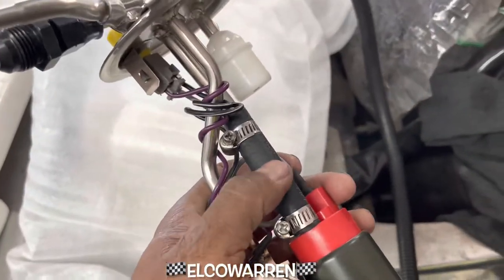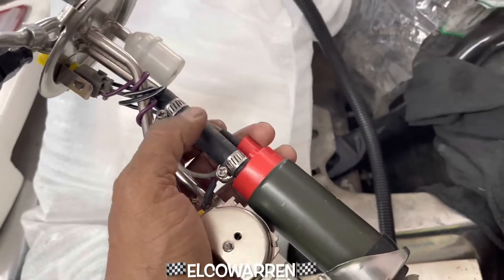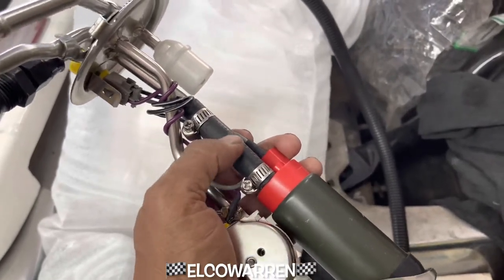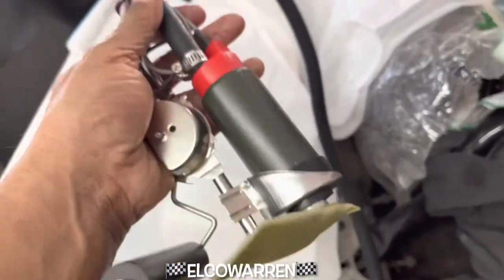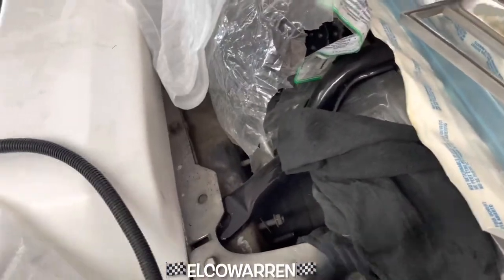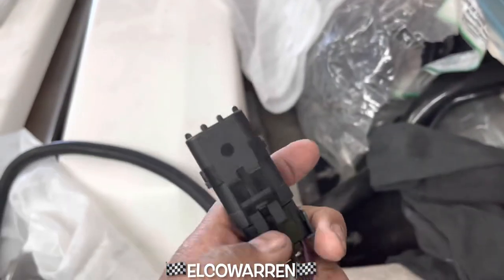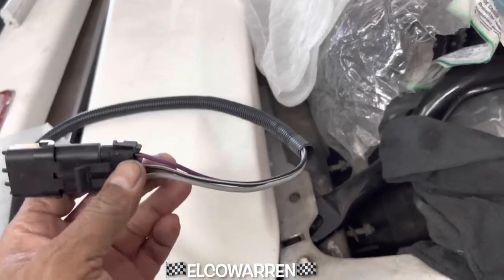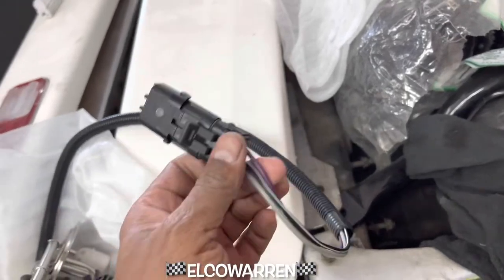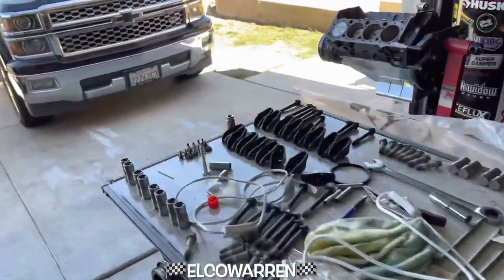I had finished it, but the hose I had I was unsure if it was high PSI. Young Elko Marcus blessed me with a nice piece of 400 PSI hose, so we went ahead and cut that up and got it on there — she's official now, she's done. We also have the end piece on here. I just need to run the wires in, stab them up in there, and we're good. Quick disconnect on there — ground, power, and sending unit signal. We are good to go.